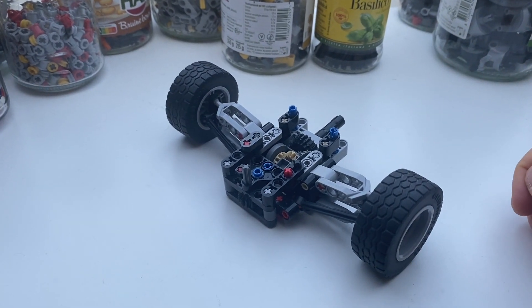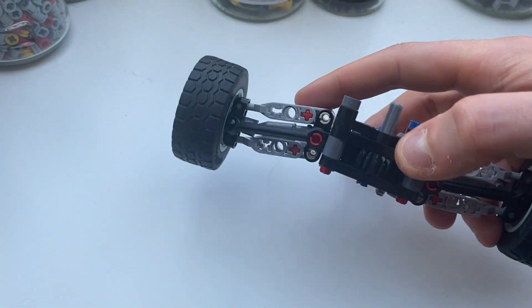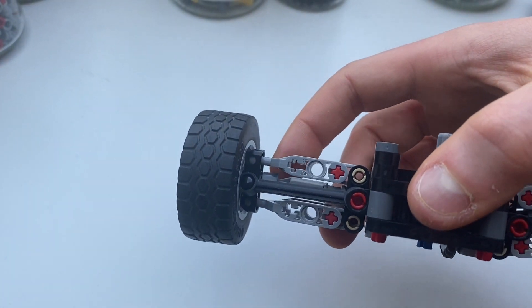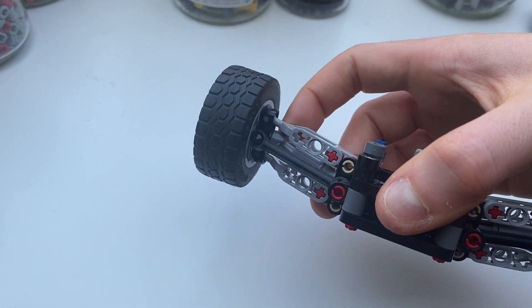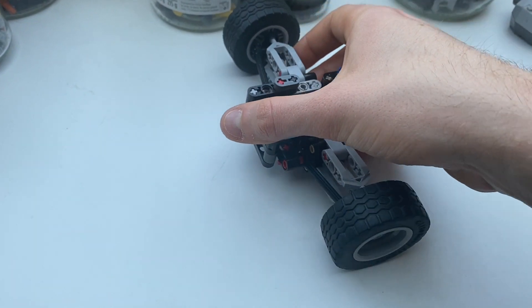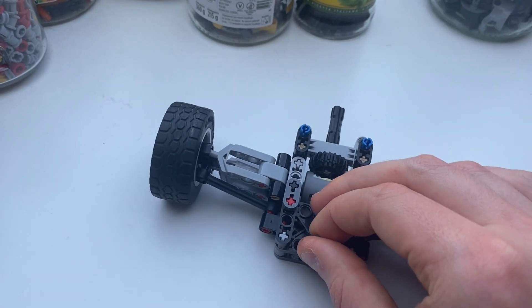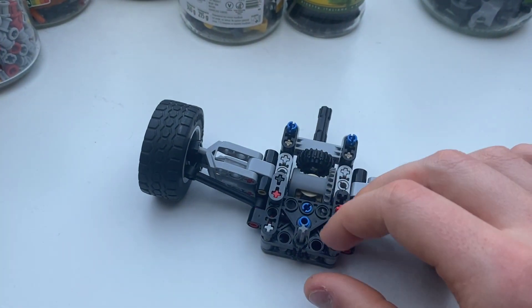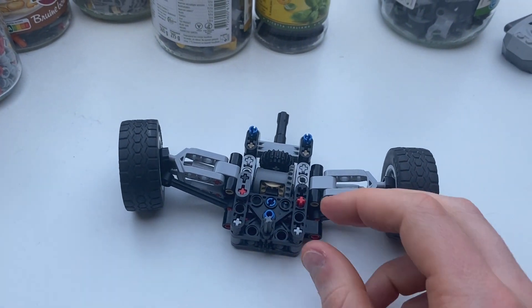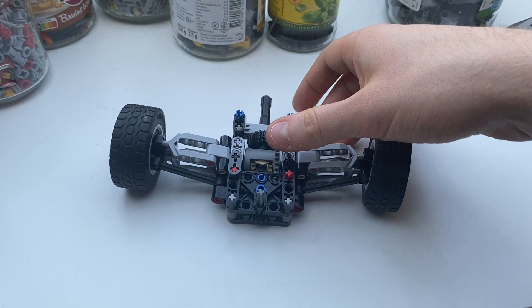This is my first draft. I'm not entirely happy with it but it's a start. I'm using this style of wishbone, which is quite uncommon, simply because it allows for more space for this CV joint to allow the suspension to move more without the CV joint hitting against the wishbone. However, my parts have it so that this ball joint is really tight and as a result the steering is incredibly difficult to turn, like unreasonably difficult.